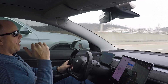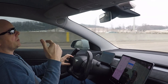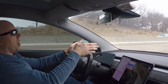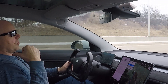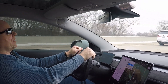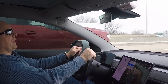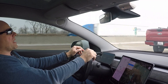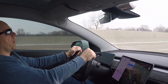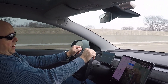For those curious, if you lower the car you do get a little bit of increased negative camber at both the front and rear wheels. Mountain Pass Performance makes both front upper control arms that are shim-adjustable and rear control arms that are thread-adjustable to correct the camber. Am I going to get those camber-adjustable arms? Probably not — between the cost of parts and labor it would be a couple thousand dollars, and there's really not enough increased tire wear to worry about.